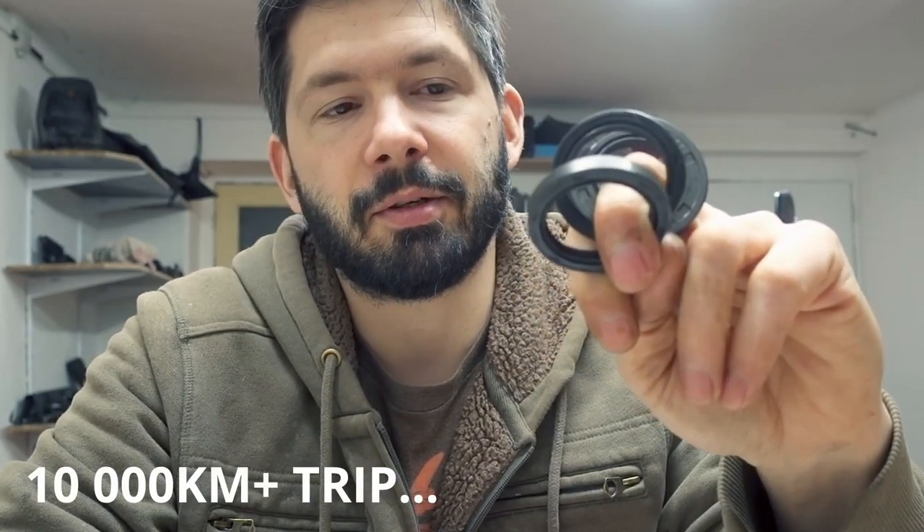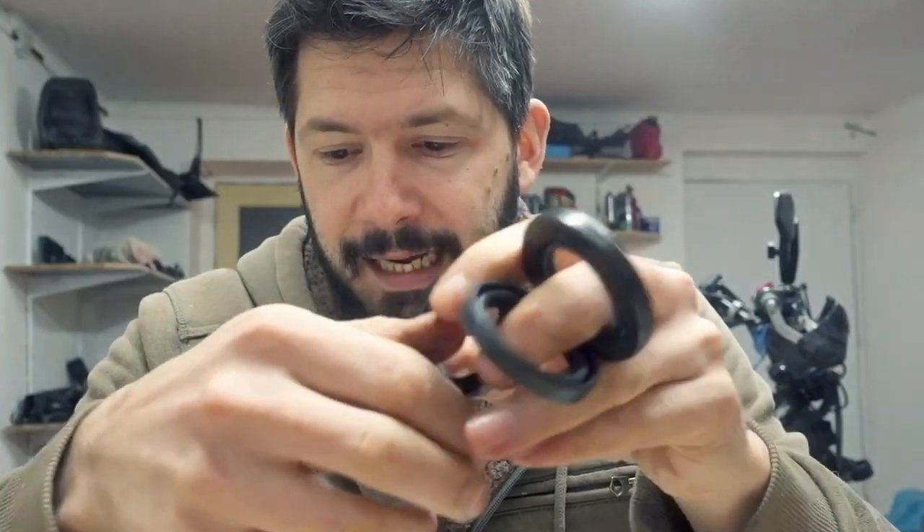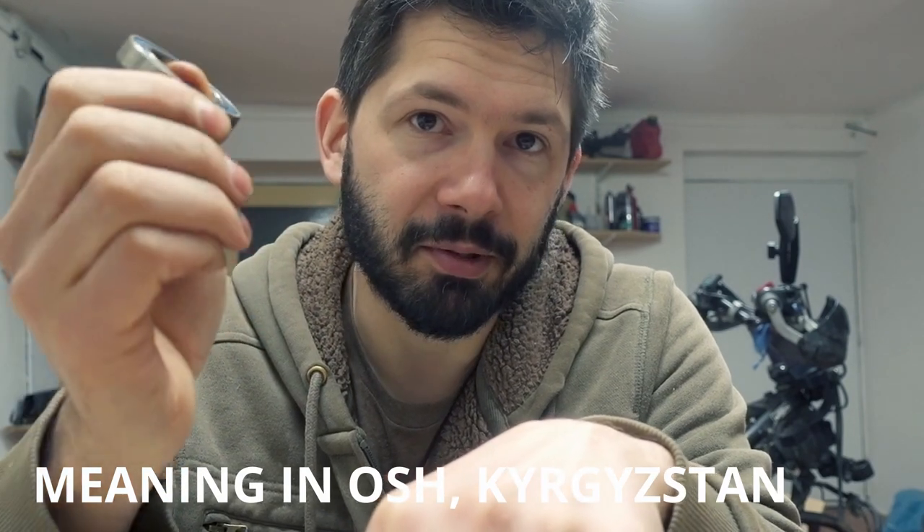One tip I'd give everybody is take a few spare seals with you on your trip. They are really small, weigh next to nothing, and most importantly it is really easy to check and change them — you just pop them out with a screwdriver and pop a new one in. That will save the bearings from getting grime and water inside. If you have a badly failed bearing in the middle of nowhere, it can cost a lot to ship bearings from Europe because you may not be able to get them in that country. Standard bearings you can get almost anywhere in the world, but the custom small KTM ones used by Rally Raid in the front wheels are much harder to find.